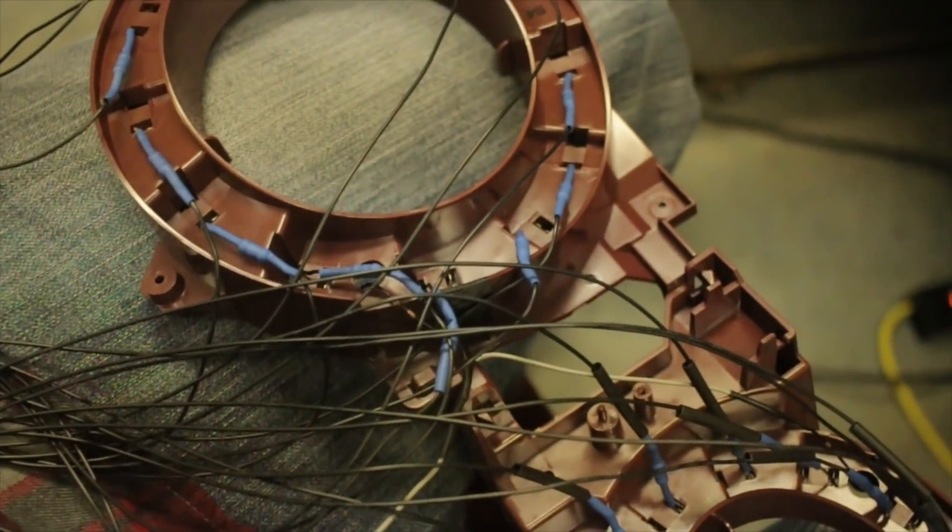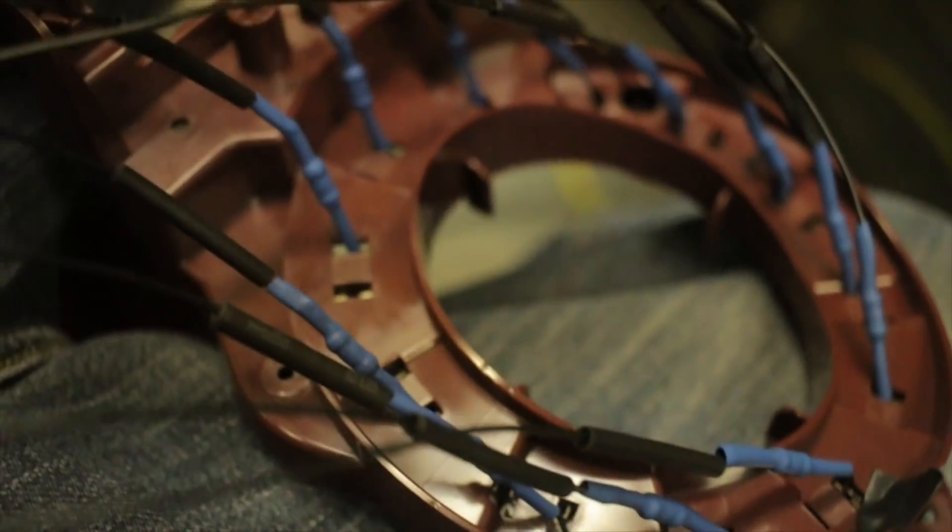If you're gonna do custom sequential work, be prepared to do tons and tons of soldering — and by soldering I mean a legit solder job with heat shrink and all that good stuff. There's no point doing this stuff if you're gonna connect it with a bunch of little push-in connectors. If you're gonna do all that work to get it legit, you might as well just do it all the way legit.